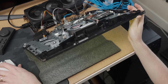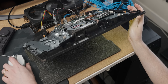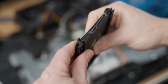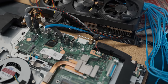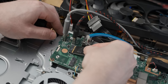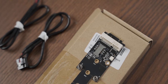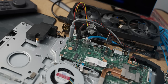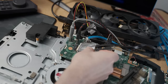It's not detecting it again. So I think the issue is the port, so we are gonna have to sacrifice the Windows M.2 drive. But after swapping in some SATA storage to free up the M.2 slot, I ran into a different problem — it doesn't work for both. Apparently it wasn't keyed for M.2. And the final adapter I bought for M.2 to Mini SATA wouldn't fit in the M.2 slot because the ethernet port was blocking it. So we're going back to the other adapter — but that also doesn't fit.